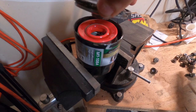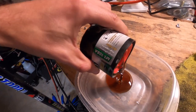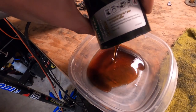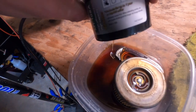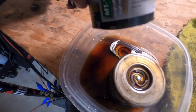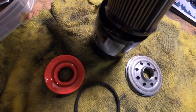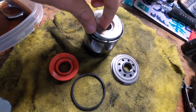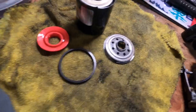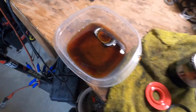We just cut the top off the oil filter, go ahead and pull that off. That oil actually looks really, really good. After review, I don't think there's really any metal flakes in there at all. I think whatever was in there was just from when we cut the top off the oil filter. So yeah, oil looks pretty good — nothing wrong with that.